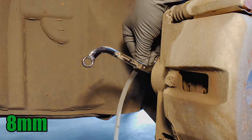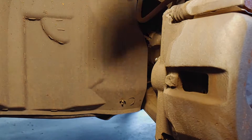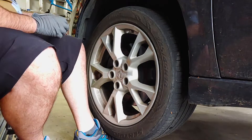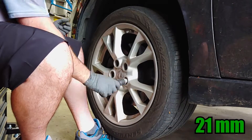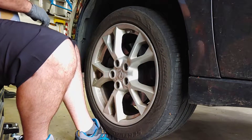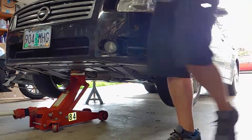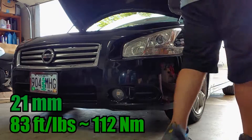When you're done, remove the hose and the wrench from the bleed screw and reinstall the dust cap. Get the lug nuts hand tight until you can torque them with the car on the ground. The lug nuts on this car should be torqued to 83 foot-pounds.